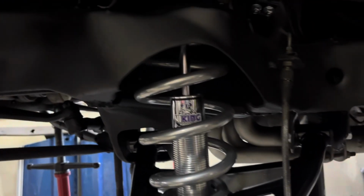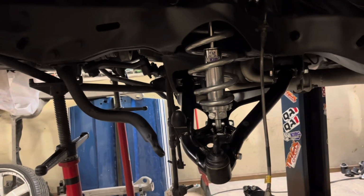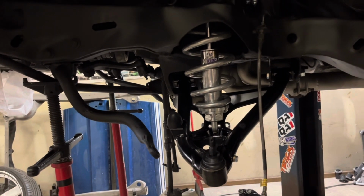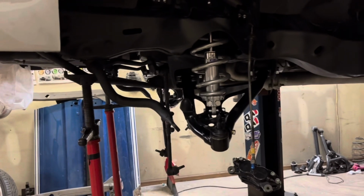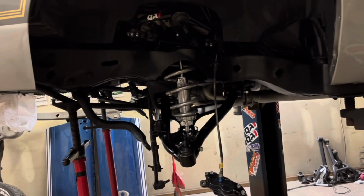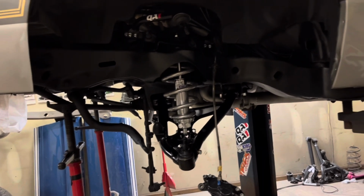This car being 4s, I had him order a 550 spring. I was probably just doing too much. It should have had a 450 spring. Kevin's car, the gold Cutlass, has got a 450 spring in it. But I do remember I turned him up a pretty good amount. So this having the 550 spring, that car was a V6 car.